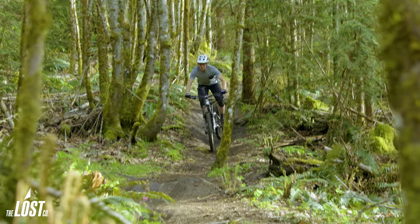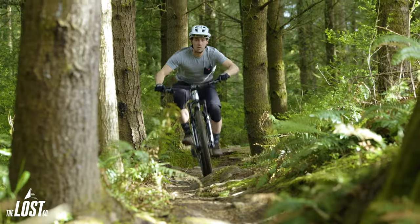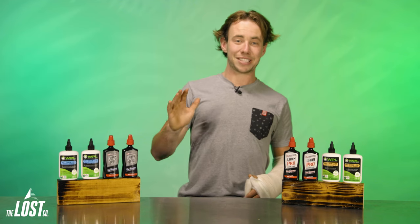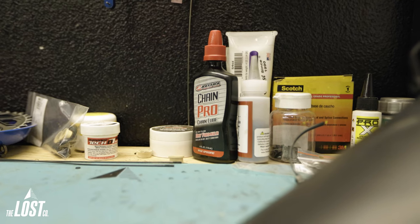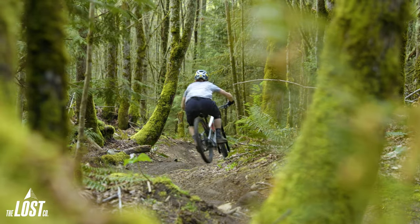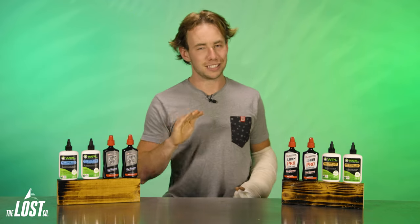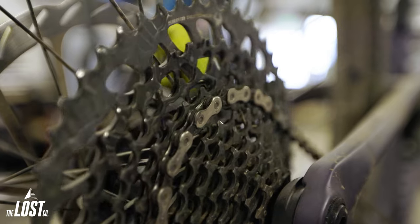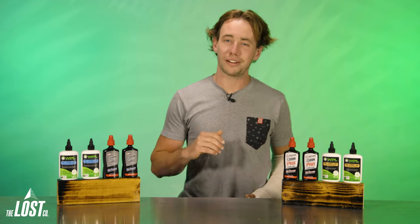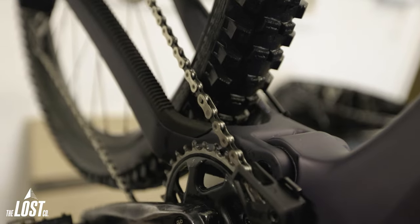Because your chain is so low to the ground and really in the direct line of fire of all kinds of crap that gets tossed up by the tires, picking the right chain lube will protect your chain better depending on what's getting tossed right at it. As you might have guessed, just like the name suggests, dry lube is designed to work best in drier conditions because it has a lower viscosity, which will pick up less dust and debris. It's not very tacky, so its greatest strength is picking up as little dust as possible, minimizing that sandpaper effect that dust will have on your drivetrain. Most dry lubes will have a paraffin wax or a teflon coating on the chain that, once dry, does a great job protecting the chain and lets it smoothly glide along those cogs.